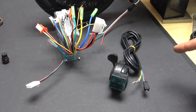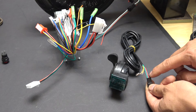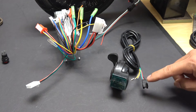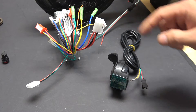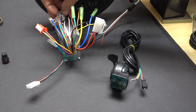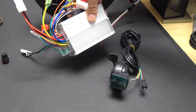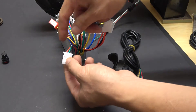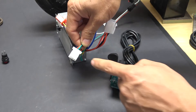Let's first talk about the one without the ignition key. This one has four wires, in which three of the wires are together in a connector — this is the throttle control wire and it goes directly to a controller. Here is a typical 36/48 volt brushless DC controller, and it has a throttle control connector which you connect this directly to.